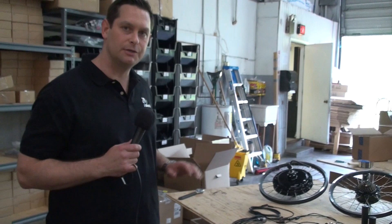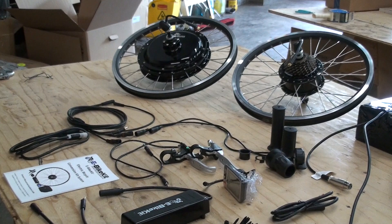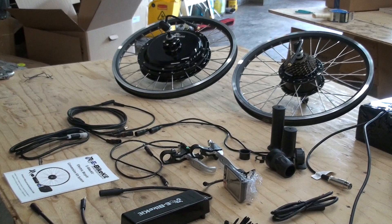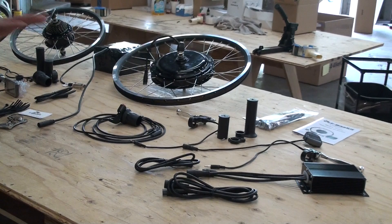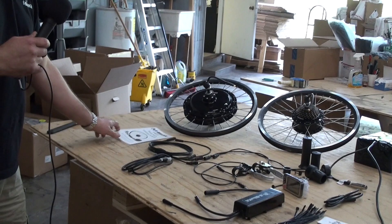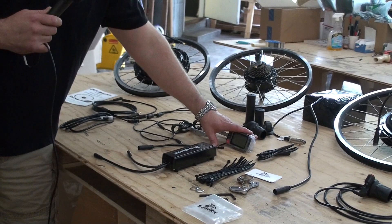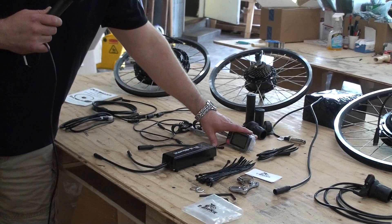So we're here at E-Bike Kit — I'm just going to show you what you get when you get a kit from us. We've got two kits on the table here with all the components laid out. One of our kits is the E-Bike Kit, that's for two-wheeled bikes, tandem three-wheelers, anything comfortable doing 20 to 28 miles an hour. Then we have the Tri-Kit, which is for sit-up adult tricycles only — that's the front-wheel kit for adult tricycles. Every kit comes with a full-color manual that shows you everything you need to know, including setup instructions for the LCD, which is really the console for controlling everything. All E-Bike Kits, no matter which motor you get, are controlled with this console — you set it up for motor type, battery type, and wheel size. It tells you everything you need, including most importantly your battery level.